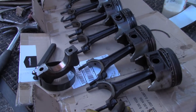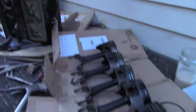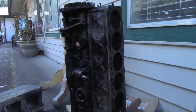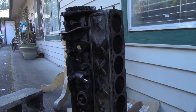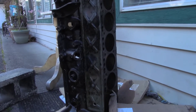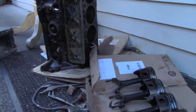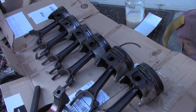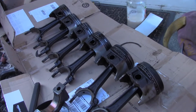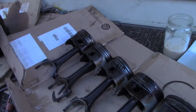This is the old Ford 300 4.9 liter inline six. I'm trying to figure out why it failed. I purchased this vehicle used a couple years ago and did a compression check — they all ran about 155 to 160. Two years later the engine started crapping out, so I pulled it apart. The first three pistons have broken top compression rings, and the back three compression rings are okay.